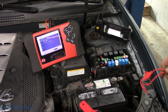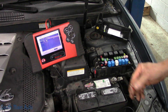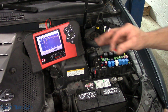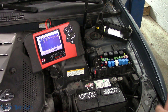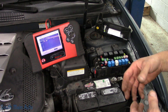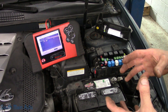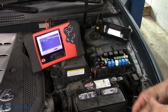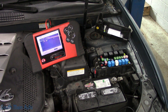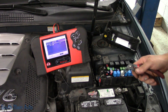That's all I wanted to see. There is no more to that diagnosis — that is exactly what I thought I was going to see happen. Someone is going to question the fact that I had the idle turned up. The physical load on the AC compressor has nothing to do with the resistance of the coil and the magnetic force it puts out. The coil is going to draw whatever amperage it's designed for — roughly four amps. By raising the RPM, the amperage should stay the same so long as voltage stays the same. I turned the idle up to cycle the compressor more and build heat to see what we saw — which we did.